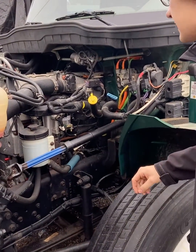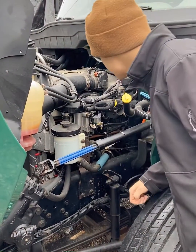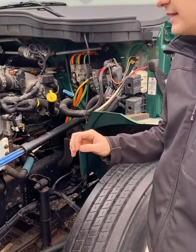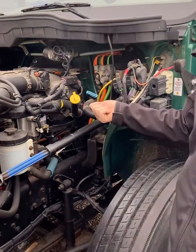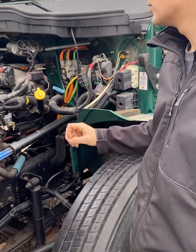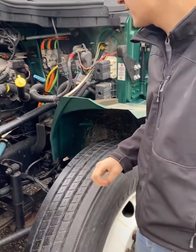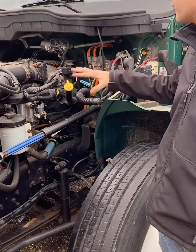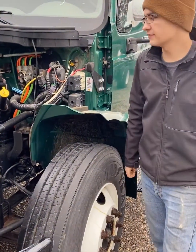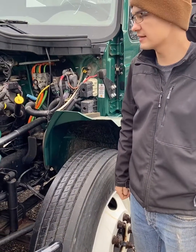Another way we can do it is on the head. It's extremely hard to see, and I can't even show it. There's a fuel pressure test port that you can crack to bleed air, or you can hook up a diagnostic pressure gauge set that Navistar supplies to diagnose fuel system related issues. So from there, after all this is done, fuel heads back to the tank or is used up by the engine. So that's how the fuel system flows on a Maxxforce DT and this EPA 2010 International.